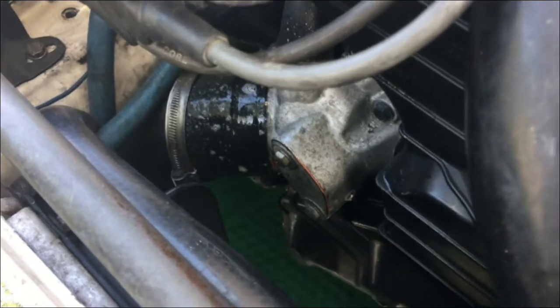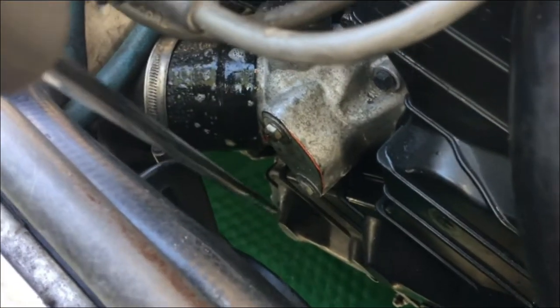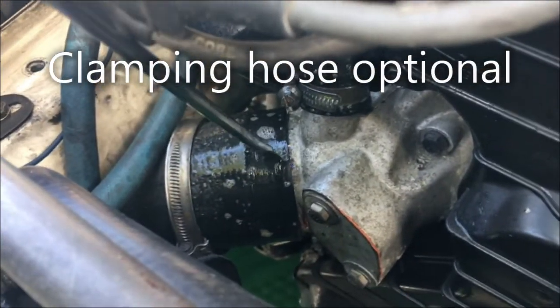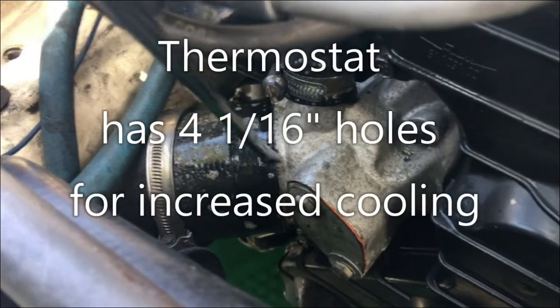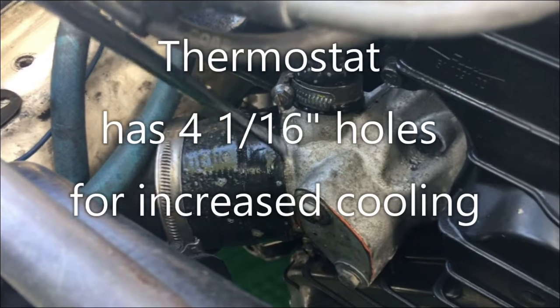Okay, I've got my bucket ready to go underneath. It's a nice big bucket. I've got the lower radiator hose pinched off with some channel vice grips down there. And what I'm going to try to do is drain coolant out of the engine, but not so much out of the radiator. So when you're taking apart hoses, obviously, especially on an old car,